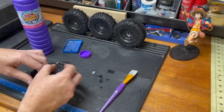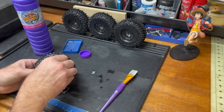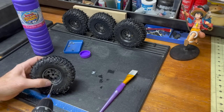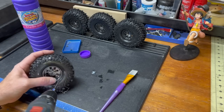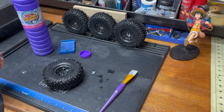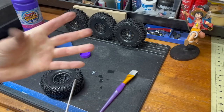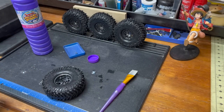I should always just show mounting the first one because that one's easy. The third and fourth tires you have to mount specifically — I need two lefts and two rights. There'll be a lip that is more folded over, and I'll generally use that for the front of the tire because it's more difficult to get the back beadlock ring in. Tire number four, we don't have a choice — it has to go the way it goes. As you can see, it's not particularly difficult, and my hands are already covered. That's bubble juice — it dries tacky, and when you get it all over your bench it doesn't matter, it just dries up and is gone.